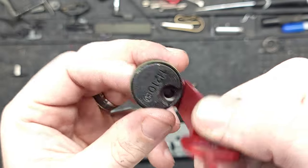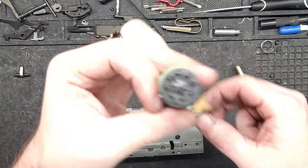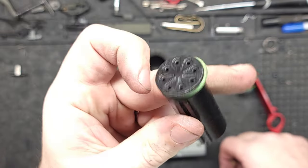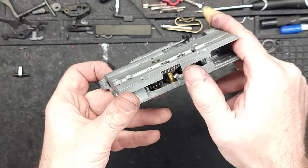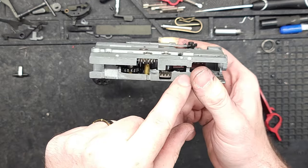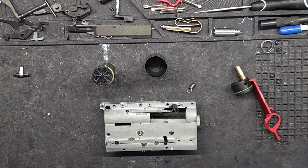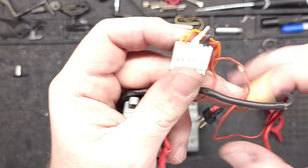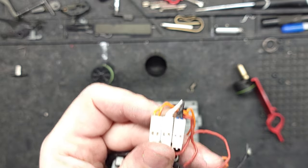I cleaned the cylinder head as well as the cylinder and put some new grease in there. Cleaned the piston head — it looks brand new again. Reshimmed the gearbox, it's good to go, real smooth, with maximum contact between the bevel and the pinion gear on the motor. Additionally, I did some electrical work — I took this little piece right here and did the modification on it.